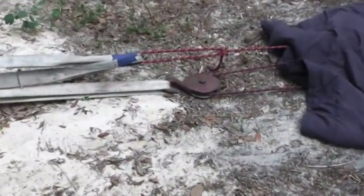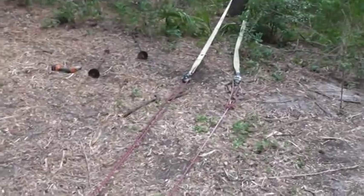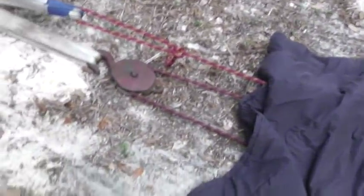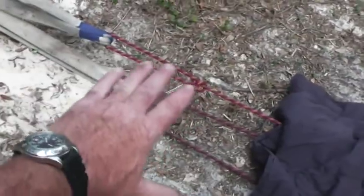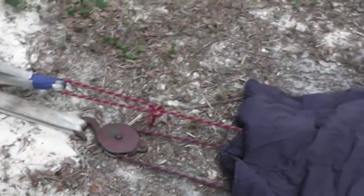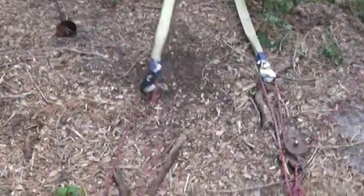The rope I have is a climbing rope I got off eBay. I don't use this one for rescue — this is just for vehicle recovery; I have a separate rope for rescuing people. A blanket or something heavy should be placed over these pulleys right here so that if anything came loose, it would absorb the energy. You'd probably want one over on the truck side too, to maybe save your back windshield.